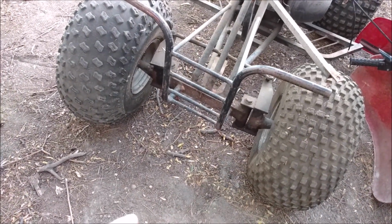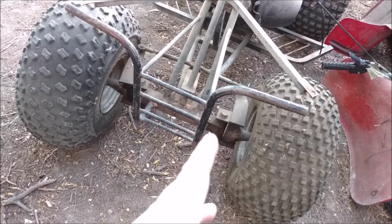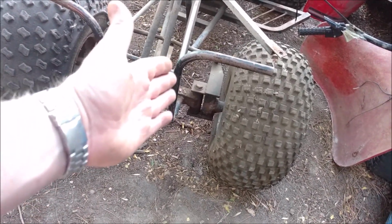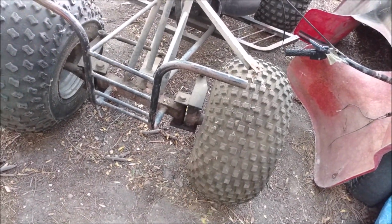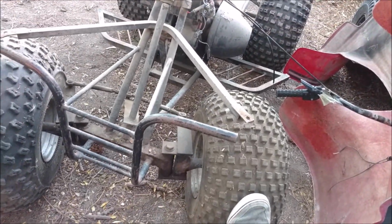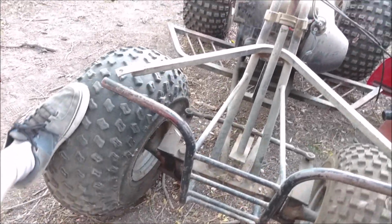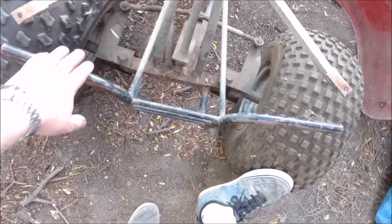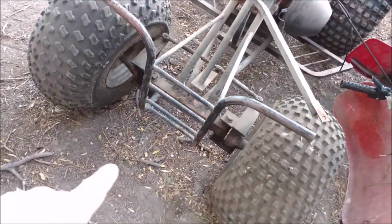And if you look at the steering, this has absolutely horrible steering because they don't have these at any sort of angle. I'm not a steering expert, but you want the kingpin essentially to point towards the center of the tire. If not, every bump you hit is going to cause the unit to steer. This tire actually has to push forward; it doesn't pivot on itself. If the kingpin sits down in the center, it will stay in place and just turn, whereas these tires have to move forward and back. So that's going to be a fun thing to drive.